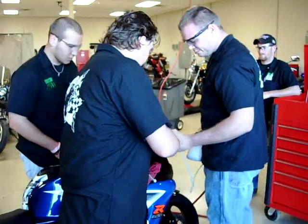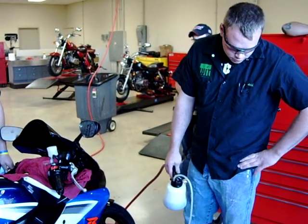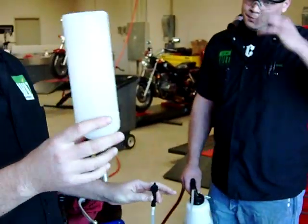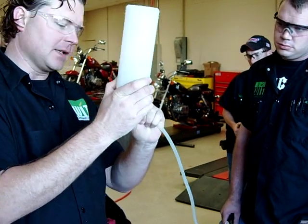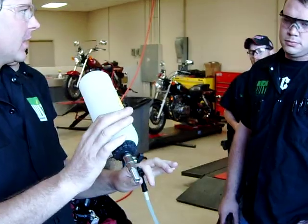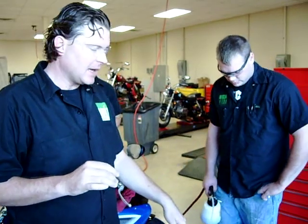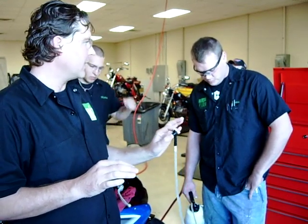What's cool about this tool is it comes with some different adapters. We've got all our brake parts in this one. There are also some different hangers so you can hang the lines. This is more for an auto application — you can fill it up with brake fluid and create a controlled slow leak. You don't have to dump the valve wide open; you can open it just a little and walk to the back of your vehicle and bleed the brakes all by yourself. Pretty cool. If SBS Brakes wants to donate theirs, theirs might be a better tool, but the last I knew, the SBS one was over $200. This one from Harbor Freight is like $30 — for everything here. So it's a pretty awesome tool.